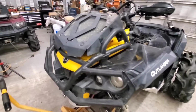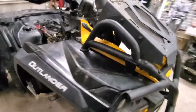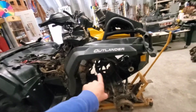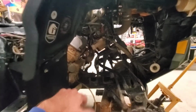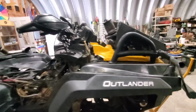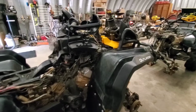And I'm back. And as you can see, got the radiator and rack installed. All the plastics are installed, mostly. Still got to tighten up a couple things, like footwell bolts, but I'm not worried about that right this second. I'm gonna change out these handguards. All the yellow plastics, like I said, are going on this bike. I'm waiting on the rad thermostat and lines that I ordered. Those should be in here in a couple days. So, yep, once that's done, I'll be able to put some coolant in her and bleed the system and make sure that's all good. Yeah, it's coming along though, guys.